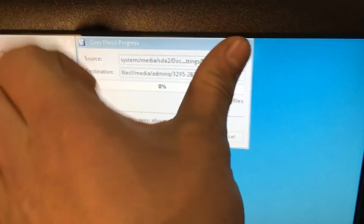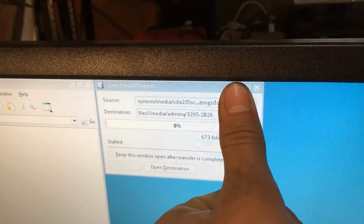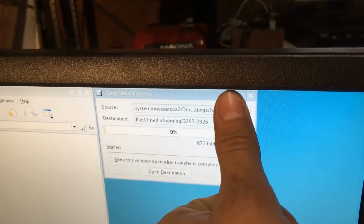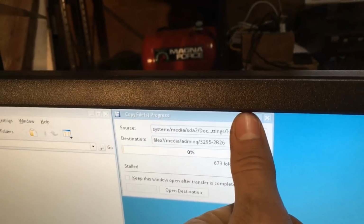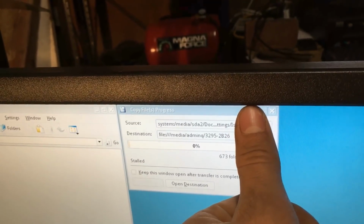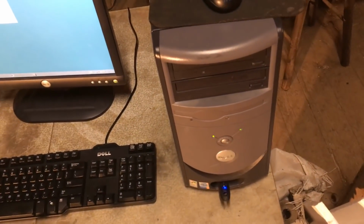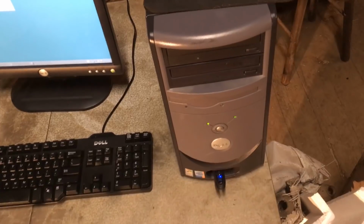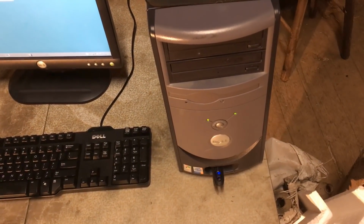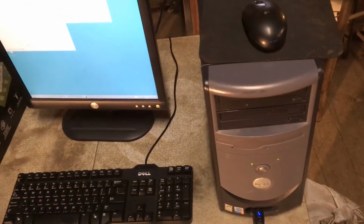But let's try to figure out where this stuff is. Covering the name there, but I did indeed find in the documents and settings folder there are 3 profiles, so I'm going ahead and just copying all the data and not fishing around, because that wouldn't be a nice thing to do. Anyway, the hard drive is not completely dead, so I'm thinking the partition, at least from a bootable standpoint, is just corrupted beyond repair. But I could be wrong. But I'll thoroughly test the drive and try to factory reset it if I can, since this guy doesn't want the computer back.